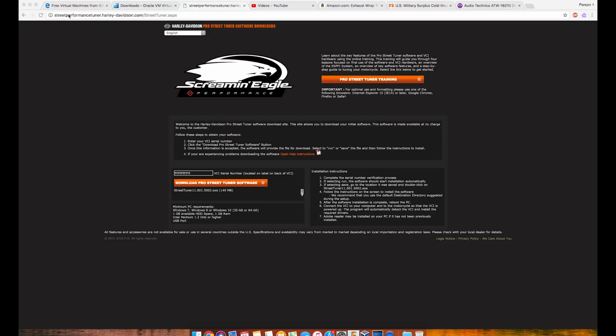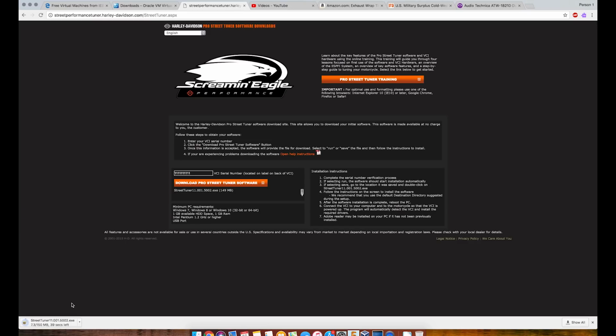So we're going to go to the Street Performance Tuner, harleydavidson.com/street tuner. On this page, you can put in your actual VCI serial number right down here, or just put in all ones. Just keep hitting one until they stop. All right, and then download Street Tuner. It's going to suck down about 150 megs, so depending on your internet connection, it may take a minute.